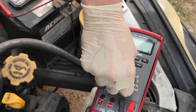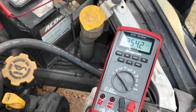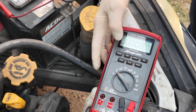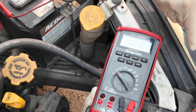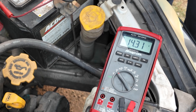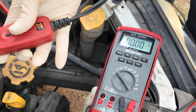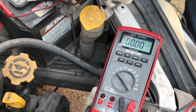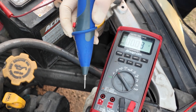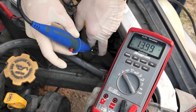Let's pull out our meter. Instead of leaving it on auto range — which will give you ghost voltage nonsense — hit the range button, watch the decimal place move, and get two digits in front of the decimal and two behind it. That'll allow you a very fast reading, bang, right to 14 volts. I don't want to hold the ground lead and the positive lead at the same time, so grab your power probe — it has a negative lead — clamp that onto the negative lead of your multimeter. Now you can kick that off to the side and work with just the positive lead.